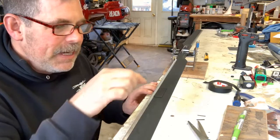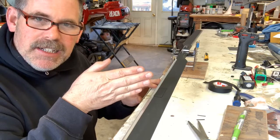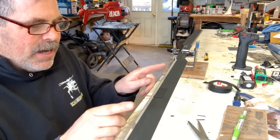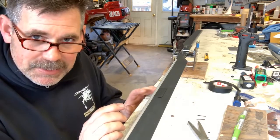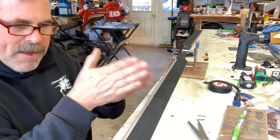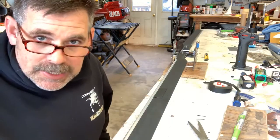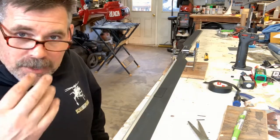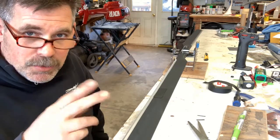I've got my little piece of tape here. I found the CG of the blade, put a little mark there, and I am centering that little balance piece right on there. If it were longer, it would be balanced on the CG. You just have to do that for however many blades you've got. Since I'm running a four-blade set, I'm balancing one and three, and two and four.